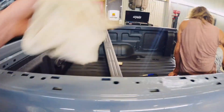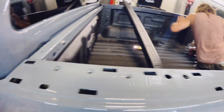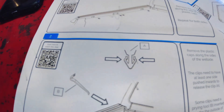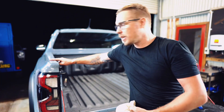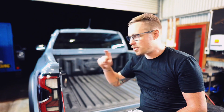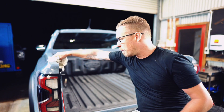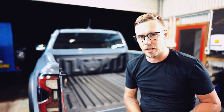We've finally got these sides off, which were a bit of a pain. Now is the step where we need to put the weatherstrip on. I'm going to go over and just clean all of that mud and dirt off with a rag, then go back over with wax and grease remover and do a final clean, ready to stick it down. This was pretty painful — just take your time, and if in doubt, give it a little pry, or you'll break something.